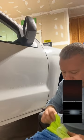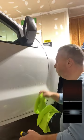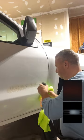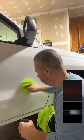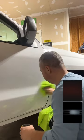It is 100% correct that you're going to get to a point where that paint is too thin to heavy cut it. You have no other option but to actually destain it. And unfortunately, a lot of the staining that's on there is going to be TFR, your road film. The only way to break road film is going to be using some type of solvent.